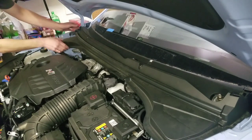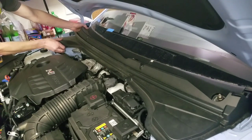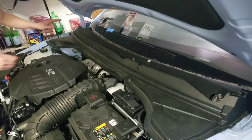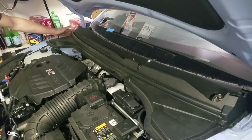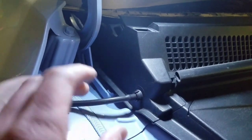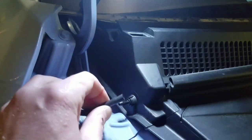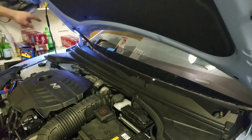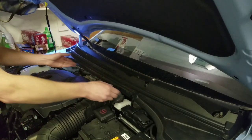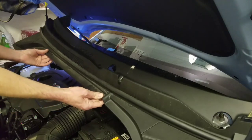And don't pull out really quick because we do have to disconnect the hose. So pull that up a little bit and pull that out. Make sure everything's clear - this is gonna come out, but let's get to that hose for your windshield washer fluid to your sprayers. Here's your hose - what you're gonna do is simply put your fingers on there and just kinda pull it off. It disconnects - there you go. Now that we have our hose on the passenger side disconnected, we can take this plastic off. Lift up and kinda jiggle it from underneath the window and it comes out in one piece just like this.